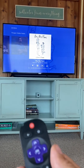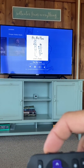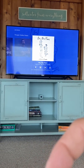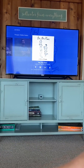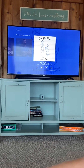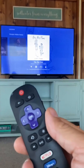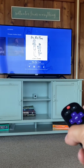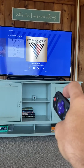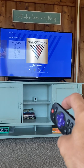To fix it, point the remote at the palm of your hand — away from the TV — hit volume up, then point it at the TV, then back to your palm. Do it again: push the button, point at the soundbar, then point away from the soundbar. The third time, point at your palm, push volume up, point it at the soundbar, then away. This lets it recognize the second signal the remote sends — the one that actually adjusts the volume. After that, you just hold the button and the volume will go up or down by itself.